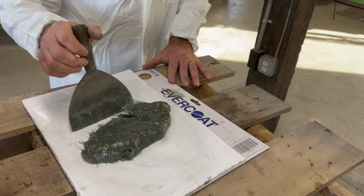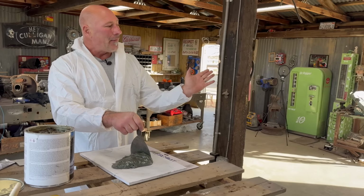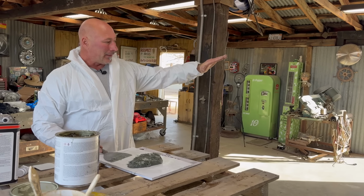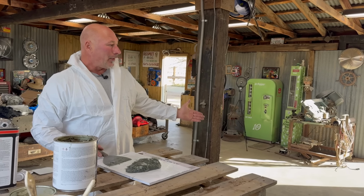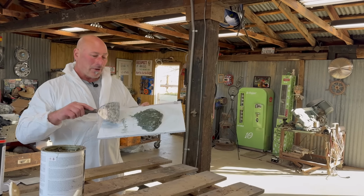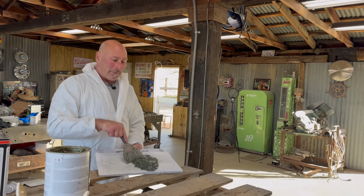And I'm gonna apply it on the back fender. And there's three layers of fiberglass matte on that transition, but it's still really low. So this stuff is gonna be a nice blast of filler to mediate that difference. Then when the fender unbolts, all the finish work underneath will get glassed in as well. So that's why this stuff is strong, but definitely not structural strong. So again, the structure will be backed up from underneath.